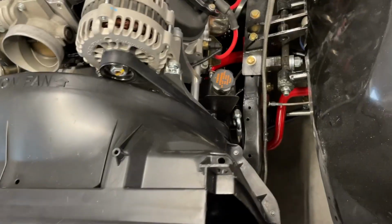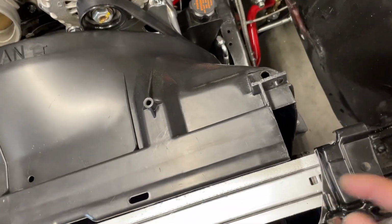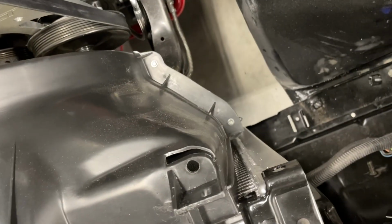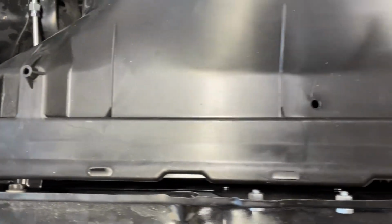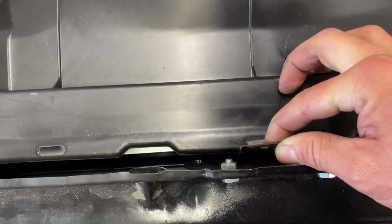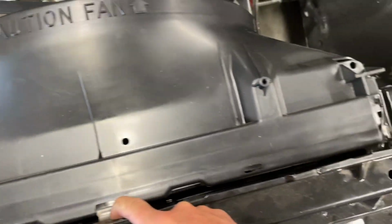That'll help. I'm decently happy with how we've got those held in place. Now the problem is it doesn't line up to any mounting brackets once it's pulled up tight. It's kind of on the edge there, just inside the edge here. There's nothing to really fasten it to. So I made this little tab bracket that I'm gonna put in here. I'm gonna paint it, and then it'll fasten against the radiator support and hold it just like we want it